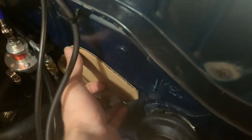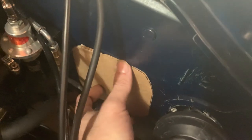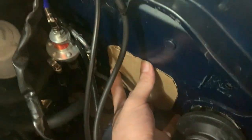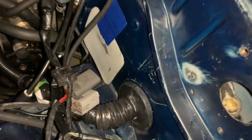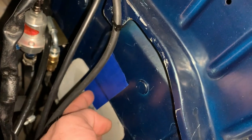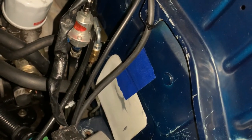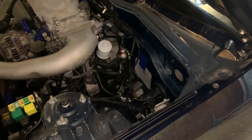With a little bit of CAD - cardboard aided design - we got a plate, and I'm going to go make one out of metal. We're going to make two plates that go on the other side to basically pinch it into place, then put some double-sided foam tape on it. With that bolted on, the car inside should be pretty much sealed from the outside once the shift boot is fully on. I'll be drilling two holes - one on each side - then paint them all black, let them dry, and mount it to the car.